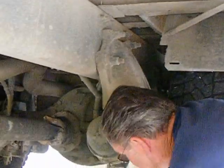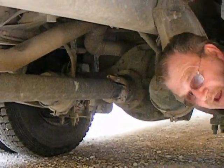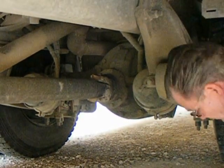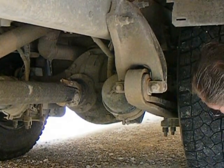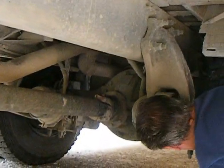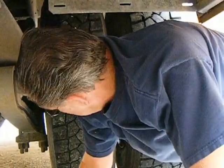The next thing I'm going to do is check my air lines going to my air chamber — they're not frayed or anything. Here's your air line going down to the brake chamber right here. This has got a dual system on it. You're going to look at the slack adjuster, making sure there's no more than one inch of travel. I'm going to look at my brake shoes. My brake drums — brake shoes should have at least a quarter inch of lining. Anything less would be bad.